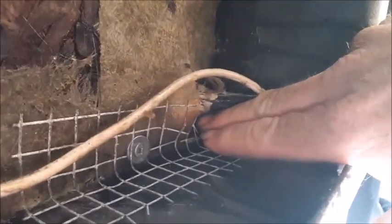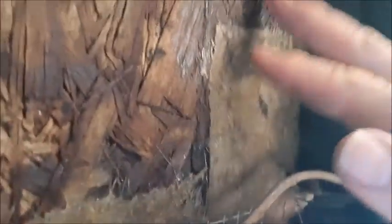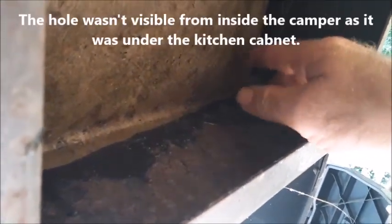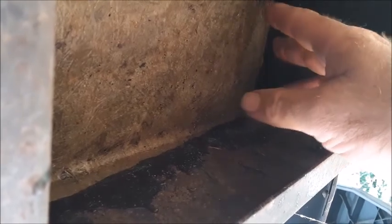Sometimes when you start looking around under these things, you'll find places where the corner of the floor — these things have particle board floors — and the corner of your floor might have gotten a little bit soft. On this spot, we actually had a place where you could get right through. This here is fiberglass, so I put some fiberglass mat because this particle board was starting to get a little bit soft. On the other side of this metal rib too it was likewise getting soft. There was a hole right here in the corner, so I put some fiberglass mat down, mixed up my resin, painted it onto the fiberglass mat, and fiberglassed it to the frame and to the floor.